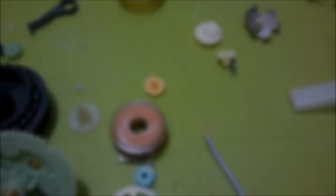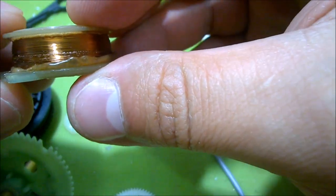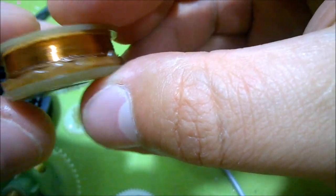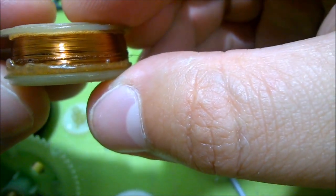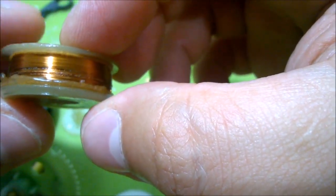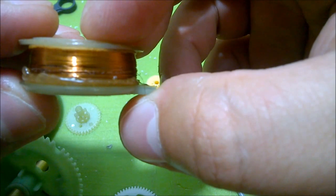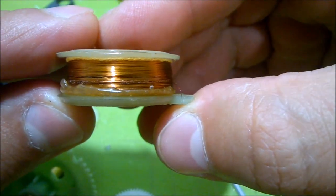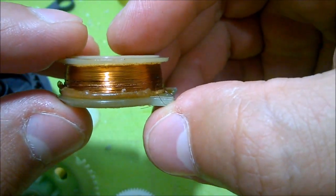Just out of curiosity, I did some further disassembly of the motor. I don't know if it shows on camera, but you can see where the motor has gone bad - there are some blackened copper wires in there where the insulation is gone. It's probably not shorted inside because when I plugged it in it wouldn't heat up. It's probably a broken wire somewhere in those blackened areas. Easy to understand why it's gone.